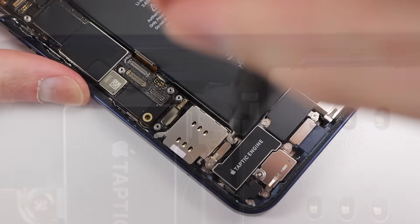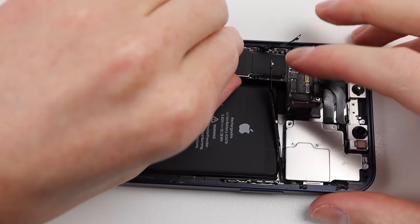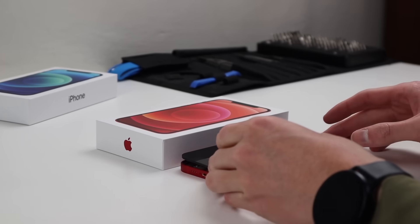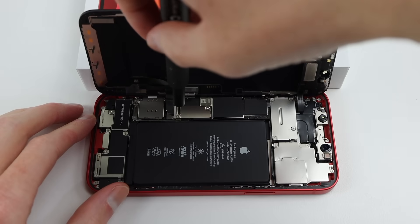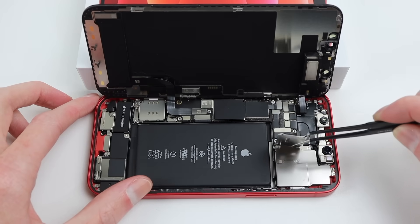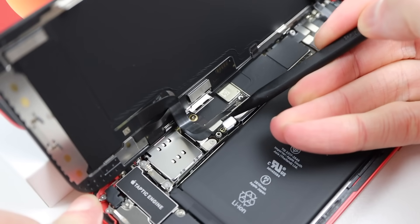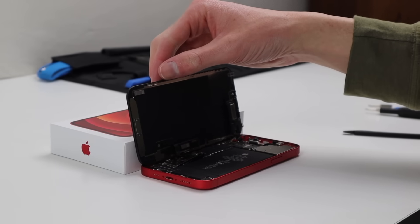Another potential repair mistake is ripping the flex cable hidden underneath this sticker. Down at the lower portion of the logic board, there is also some shielding which I'll need to remove to access two more flex cables. After disconnecting those, I can remove the four screws holding the logic board in place for the iPhone 12, plus one screw connecting to the camera assembly. I thought I would remove the SIM card mechanism for more clearance, however one of the screws was already rounded from the factory, so my screwdriver wouldn't grip it. Luckily, I was able to get the logic board out without needing to remove the SIM card mechanism.